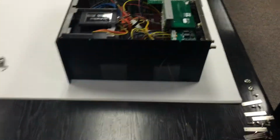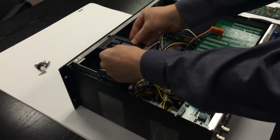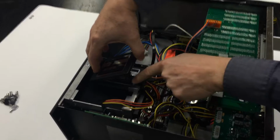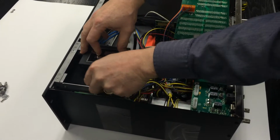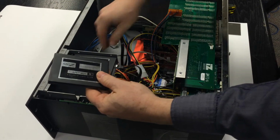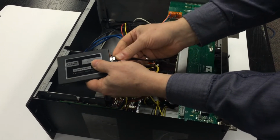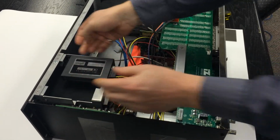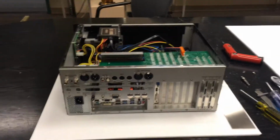The last thing we're going to install is the radar mode drive. And so the radar mode drive just sits right on top of your Windows drive. So now you've got two system drives. You've got your Windows drive and your radar mode drive. We put two screws in the side here. We plug in, well actually we'll plug in the SATA power first because it's easier. And then we're going to plug in our SATA data. And the cables are already here. You don't have to install the cables, they're already here and connected in the right spots. And then fasten two screws in, put the lid on, and you now have a Radar Studio frame with core kit installed.